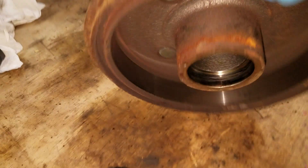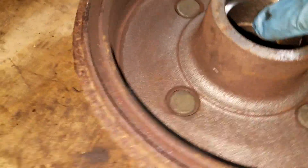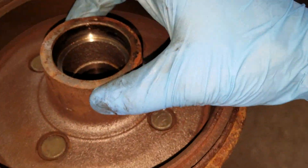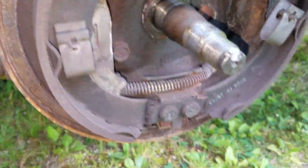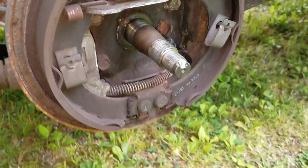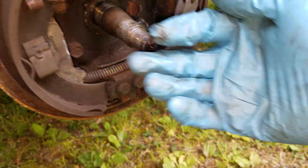What's going on here is this bearing goes in like this because you want the grease to stay inside the hub. Usually how cars do it is there's a machined surface around here, which obviously isn't on this hub. Usually that's a machined surface, and if we go look at the car, usually back here there would be a grease seal, and the hub would slide into that grease seal — that's what would keep the grease inside of the hub. On this side, there are no seals in the bearing, which allows the grease to flow all the way out around the thread where the nut goes.